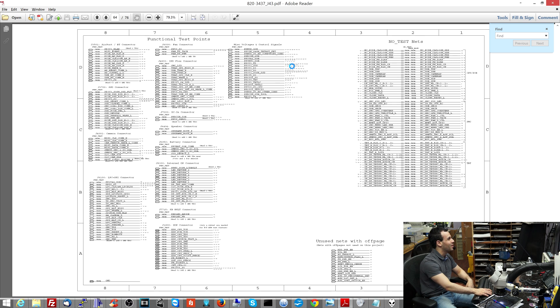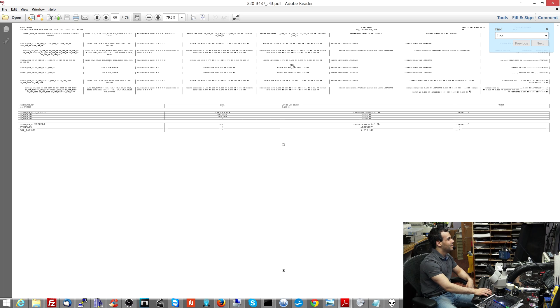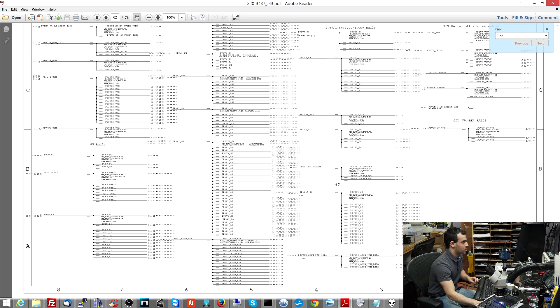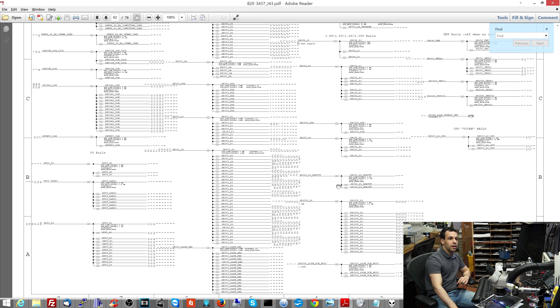Because there they actually give you this from the manufacturer. There they actually tell you how to fix their own products. So I'm going to scroll here. This page is called power aliases. As I've explained, everything on the Airs and Retinas is more miserable than on the regular machines, and that's even down to the schematics. On regular schematics for A1278s and A1286s, you used to get this whole list on pages 1, 2, and 3. Now you get it on page 62 — not at the end, not at the beginning, on page 62. This is the first place you should look when you have any problem with a computer not turning on: page 62.